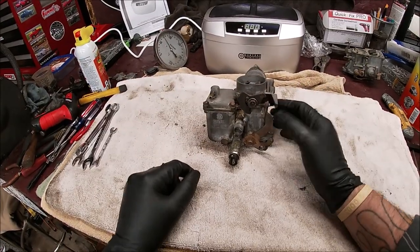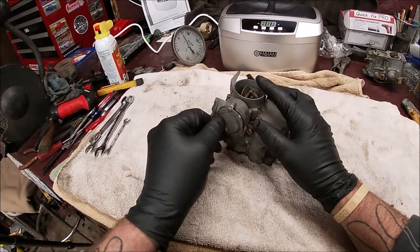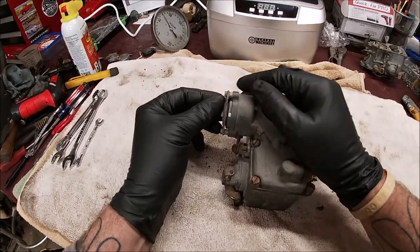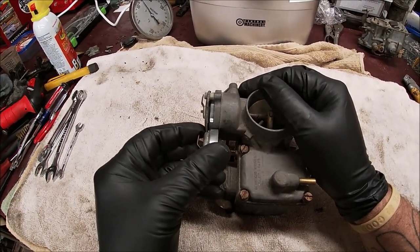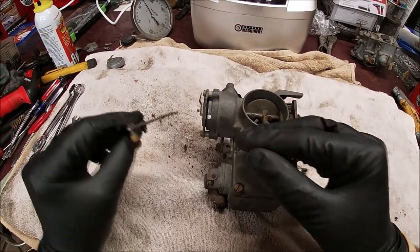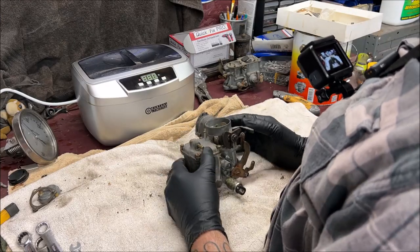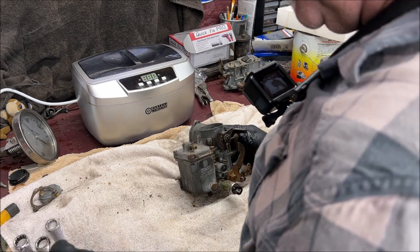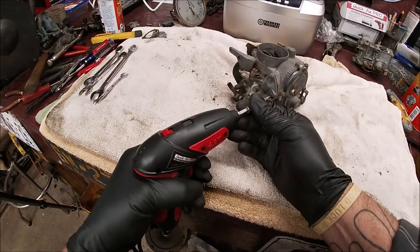First thing is first - let's turn on our heater on the ultrasonic, then we can start taking the carburetor apart. This thing's been sitting around for a very long time. Looking it over, I can turn the choke thermostat but the screws are tight, so I'm going to have to figure out if this needs dimpled in more - it doesn't look like the right one, it looks like it's sitting too loose. This one looks like it was in a fire; I can see fire extinguisher residue. Let's start taking it apart - I'll use a small screw gun, not my big Milwaukee, to avoid breaking something.